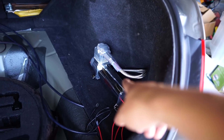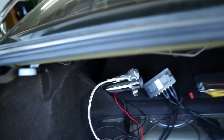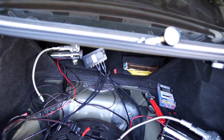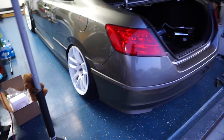I just want to get the second compressor in first alongside the tank, and then we'll see where this takes us. Just a follow-up on my wiring — I connected the red, black, and black wires and they're already all the way up to the battery up front. We're going to mount up the compressors and see if both of them turn on. We actually got the second compressor to run. I'm just calibrating the system — calibrating the front and now the rears. The fronts are at zero and the rears are recalibrating.